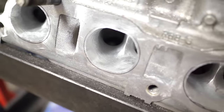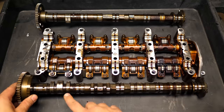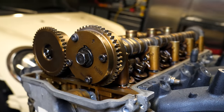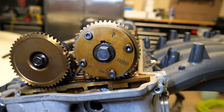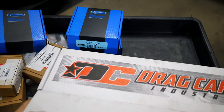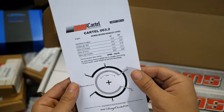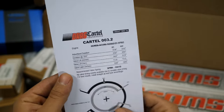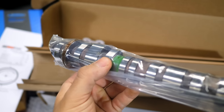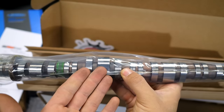I have more information in my spreadsheet regarding these details. The components in the head, such as the stock camshafts, will not suffice for this build. The K24A2 cams are some of the best OEM camshafts you can pick up. However, they still aren't adequate for our NA 300 horsepower goal. I'm swapping them out for Drag Cartel 3.2 camshafts, which have both longer duration and lift over the stock cam profiles while keeping the characteristics of a street camshaft. The intake cam will allow more air to enter the combustion chamber, and the exhaust cam will allow that air to escape more freely.